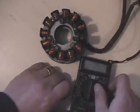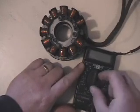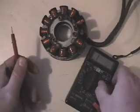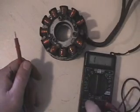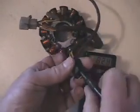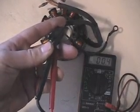On your multimeter, put it on about the lowest setting you have — on mine it's 200. Some digital meters don't have settings; you just put it on the ohm symbol and it reads what it reads. First thing we'll check is our power side. Find your two yellow wires, and go ahead and plug those into the two female connectors — doesn't matter which is negative or positive. On my multimeter it's reading 0.4 ohms. We're basically just looking for continuity to make sure the wire isn't broken. So we know our power is okay.